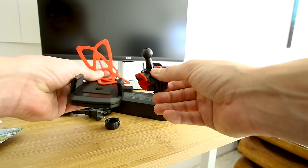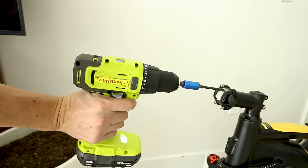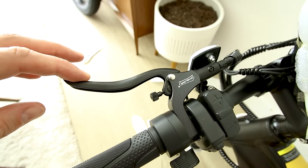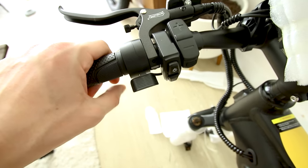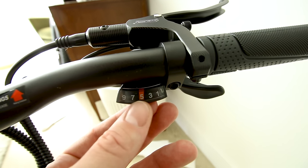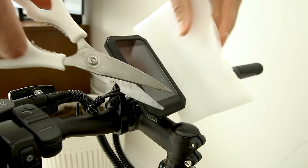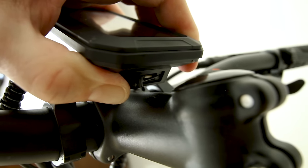With a 15 amp hour battery pack divided by a 3 amp charge rate, it'll be about 5 hours to charge from zero to full. This electric bicycle also comes with a motorcycle phone mount, which might be beneficial when testing the top speed. The handlebars are mostly flat with a slight rise. There's a little reflector on front, Dyisland brake levers, round rubber grips, and a thumb throttle on the left. Controls include horn, lights, and nine speeds on the Shimano Altus shifter — typically I see seven or eight, so a couple more than usual.